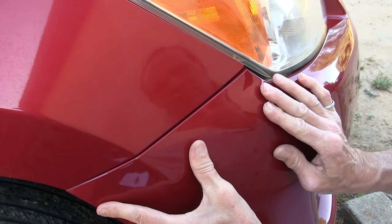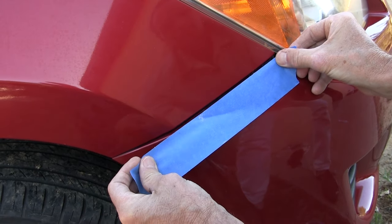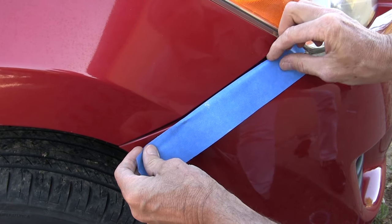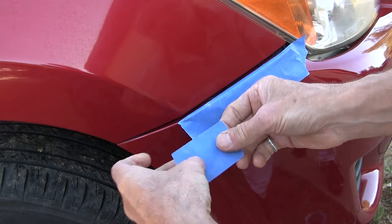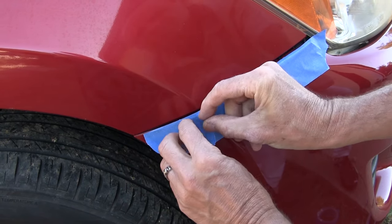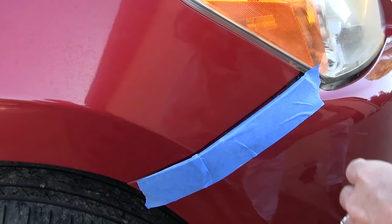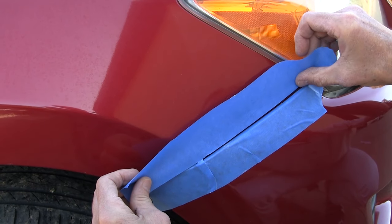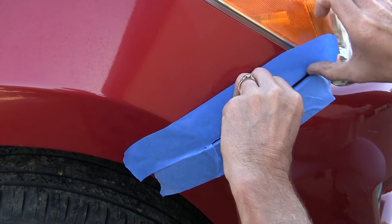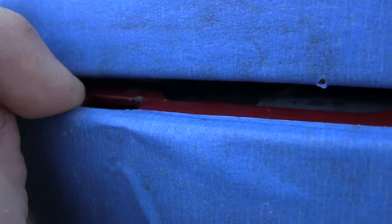The first thing you're going to do is test the bumper and the quarter panel for proper alignment. Once you have the alignment figured out and you're confident that your seam is going to be consistent, you're ready to prep the bumper with your painters tape. This tape ensures that you don't have any mess with the glue on the outside portion of the seam. You want to make sure the only area that has the adhesive is on the inside of the seam so that your job looks clean. Place the painters tape all the way to the inside shoulder of the seam. Next, identify the contact points, which are most likely the two areas where the clips failed — these are the places where you'll apply your adhesive.